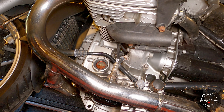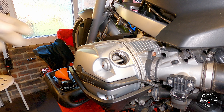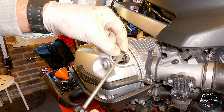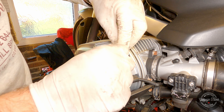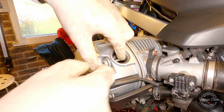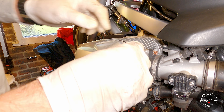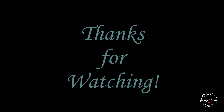And indeed the level has dropped a bit, so I'll top that up and we're done. When I got the bike it looked like there was a bit of oil mist around the fill plug, so I'm going to put a new O-ring in there before I give it back — some silicone oil on the new one so it slides in easier, then pop it in. And there we go — job's done. Thanks for watching and I'll see you next time.